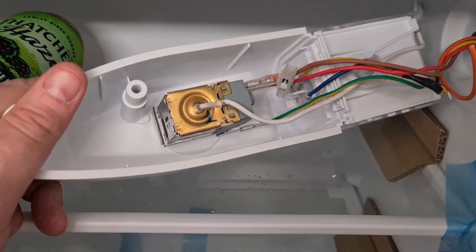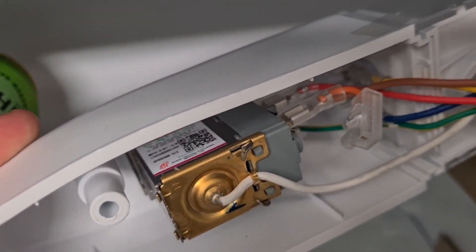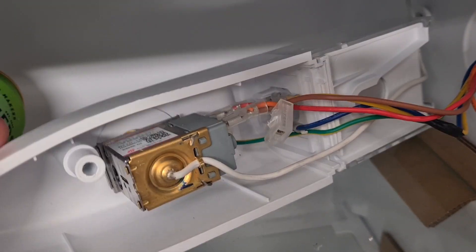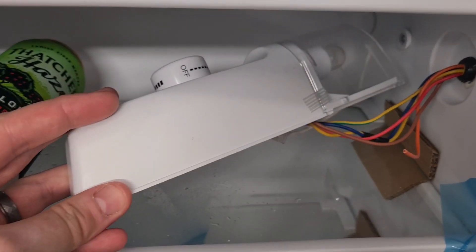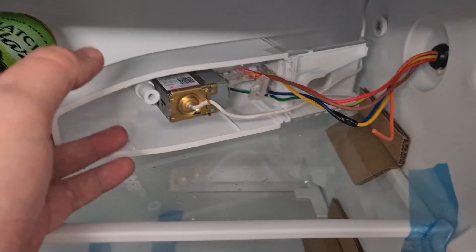The next thing to do is take note of what other colours are going to this thermostat. I can see at the back I've got red and at the front here I've got brown. Red and brown — that's all we need to remember. At that stage you can fit this thing back on and you're done inside the fridge. It's probably worth mentioning most fridges are slightly different and the wire colours might vary, but electronics tend to be very similar on this sort of thing. Hopefully this makes sense for your fridge as well.